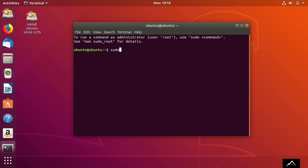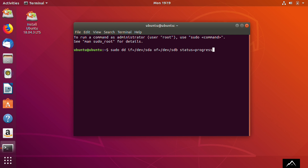We're going to initiate the duplicate disk or DD command. This one simple line will do all the work of cloning our drive. But you need to ensure you do it correctly because entering the wrong input or output file can wipe your hard drive, so be sure you identified your drives correctly. The command starts with sudo — which is super user do, giving us elevated access — then space, then DD (our duplicate drive command), then IF= which is our image file or old hard drive. I identified that as /dev/sda. Then OF= which is the output file or the new SSD — mine was /dev/sdb. Now another space and status=progress, which will allow you to see the cloning process. Without this command you'll just see a blinking cursor leaving you to wonder if you screwed up. When you're positive you have everything entered correctly, hit Enter and the cloning process will begin. I provided the command in the description below so you can just cut and paste it and edit it with the correct drive labels.